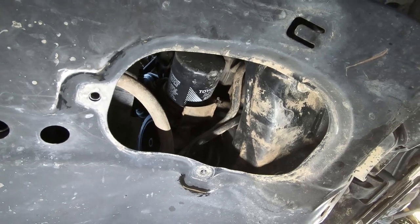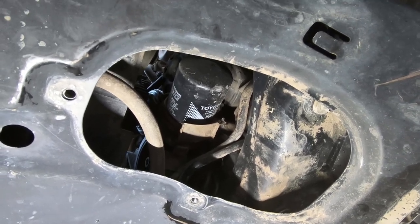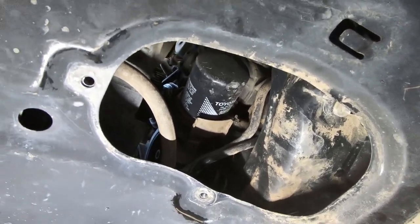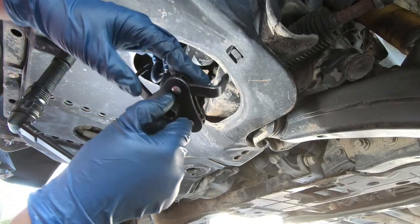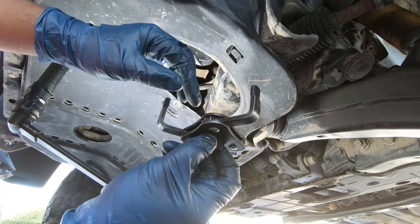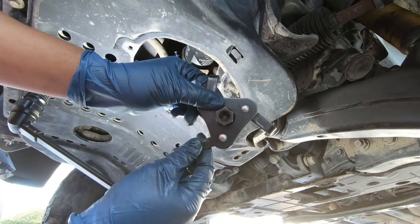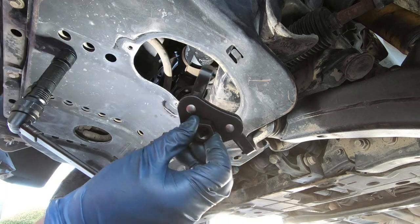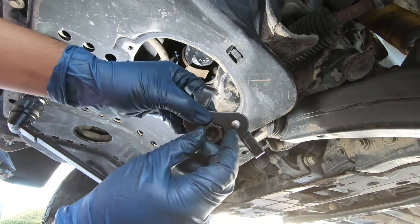There is the engine oil filter. As you can tell it's a Toyota piece because I was the one that changed it last time. When you do your own oil changes, it is very important to take a look for any leaks or check if the last person used a quality filter. For getting the oil filter out, I really like this oil filter wrench — I'll have a link in the description below. What's nice about it is it grips really well around the oil filter because it has three prongs, and it's adjustable for any size oil filter. If you have a few different cars that use different oil filters like I do, it will work for every single one of them.